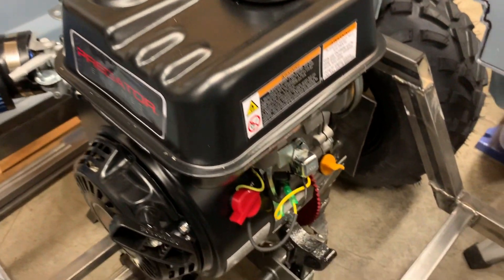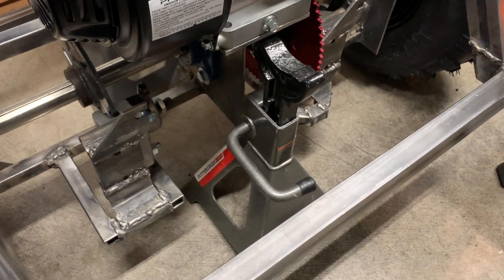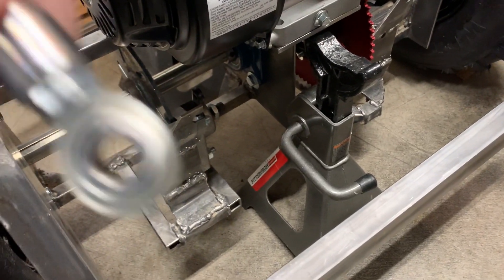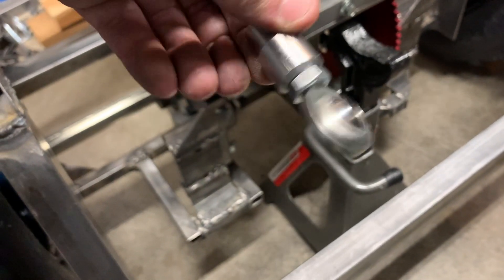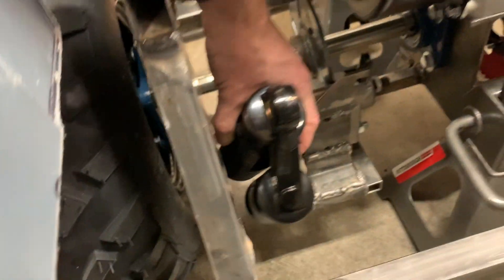Here is the ideal plan for the suspension. I want to do a four-link suspension setup using four separate links, with these tie rod ends or heim joints to allow for the flex that I need. On the edges, I want to use a coilover from the back of a motorcycle, one on each side. The big plastic body is definitely in the way of a comfortable build, so let's start by cutting the tailgate out to make room for the cold air intake, and then we'll remove it.